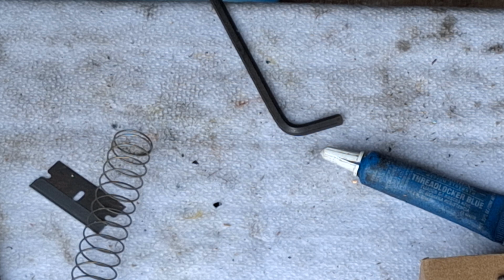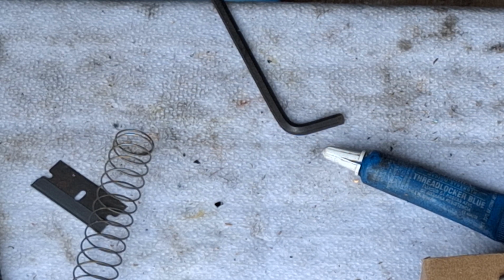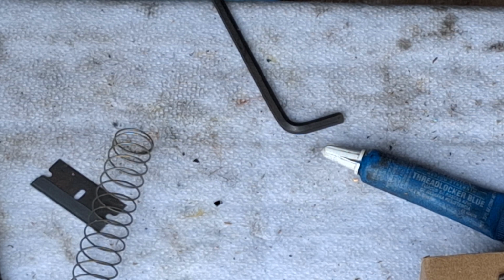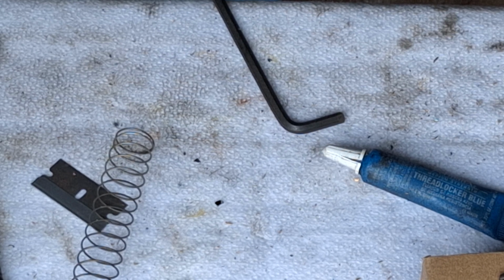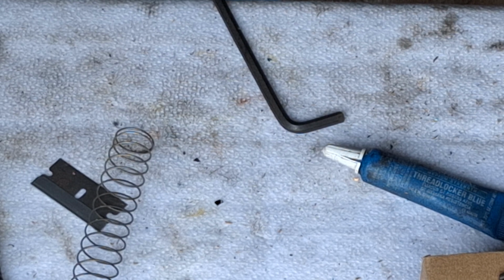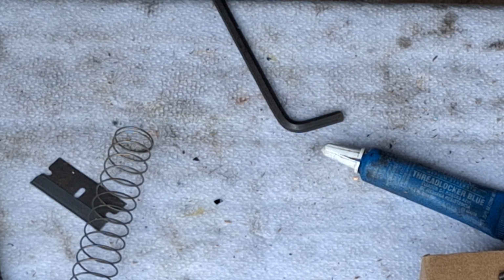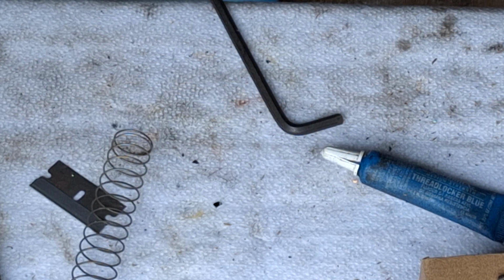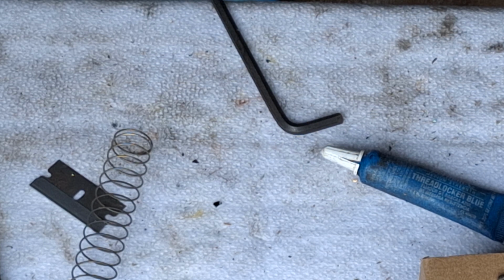Have to do both holes here because neither one of them really fit in there. So if you got one that's really tight, whether it's aluminum or plastic, probably need to run a quarter inch drill through there. Just do it by hand. You're not going to hurt anything by doing that. Sure beats spending an hour trying to beat the damn ferrules in there. Okay, let me do the return side here.